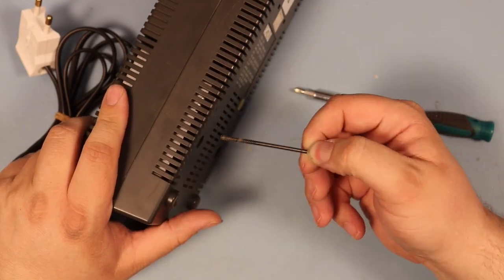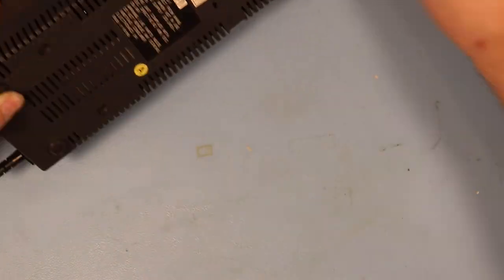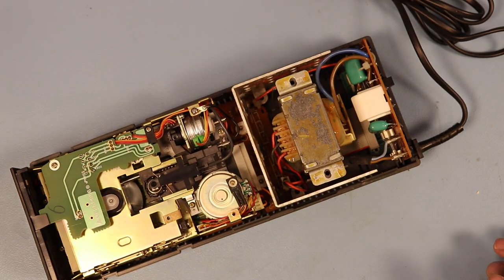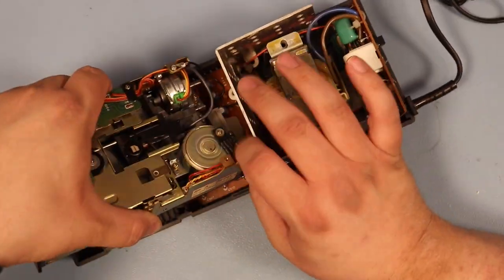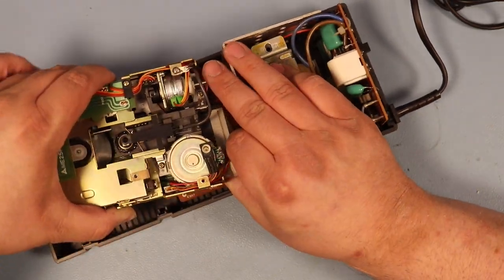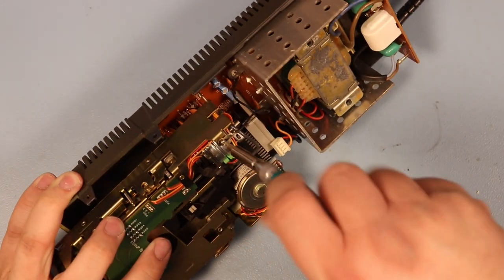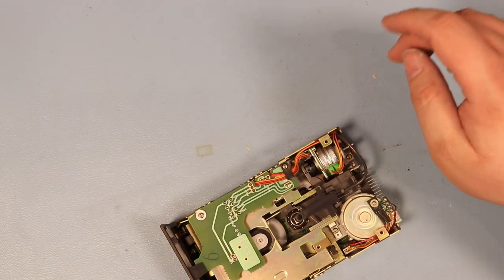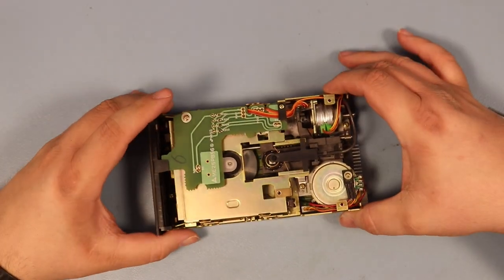Getting the drive out of the case is easy. There are two large screws on the bottom holding the top lid and the transformer in place, and four smaller ones on the sides holding the drive itself onto the lid. I remove the lid, and then disconnect the cables — first the power and then the data cable. The data cable is smaller than an ordinary floppy cable. Finally, I remove the screws for the grounding cable and put the cabinet aside. I'll save the cabinet and screws so I can put it back together if I get another spare three inch drive.